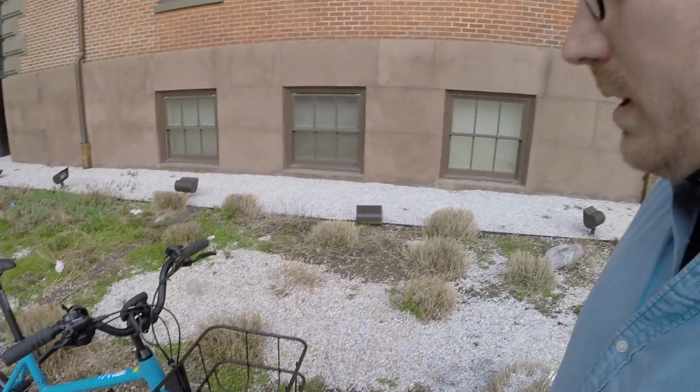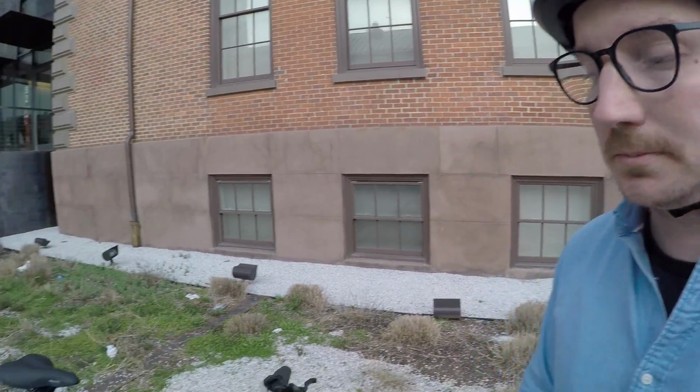Yeah, one of the things is the quill stem. It does give you some adjustability, but really the standard these days is the threadless stem that we see on most mountain bikes and that sort of thing. It just ends up giving you a little bit more firm responsiveness and a little bit of a stiffer ride where you need it, really in the handling. Well, thanks for giving that.